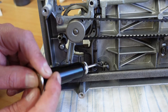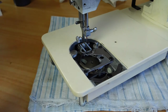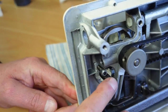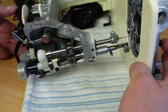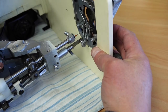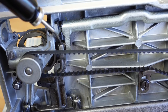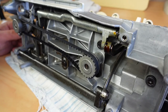Let's go ahead and oil the feed dog linkages — just either side of that. I should also lubricate down in that middle hole in the hook there. A bit of oil onto this throat plate slider as well — push that out and get a bit of oil onto it. And there's the feed dog cam follower — oil that one. I think that's about it for the oiling and greasing — I hope I haven't missed anything.